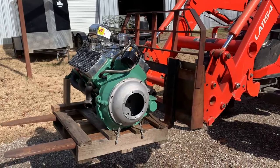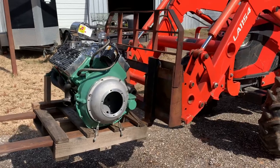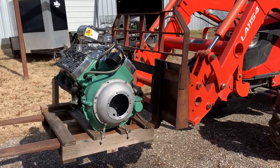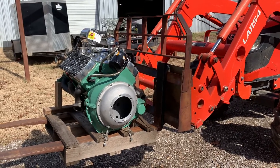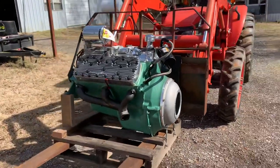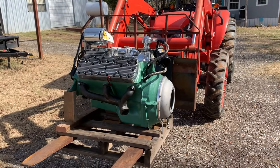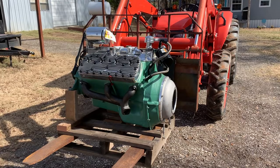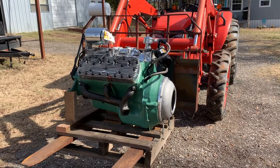So what are we looking at here? Tim McMaster — he was the Y-block guy out in California. We'd known him for years and we wanted a really quality flathead Ford built, so we got a hold of him. It's a 59 AB style engine, 304 cubic inch. Basically it's just for driving — getting out on the road and actually driving. It's going to have Auto Trend EFI 97 fuel units on it, which will look like the Stromberg, but this car is going to run down the road.